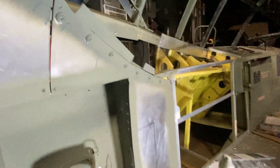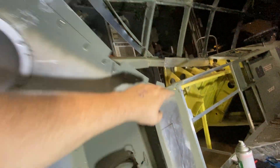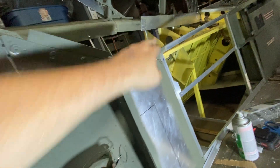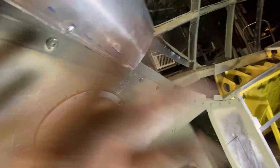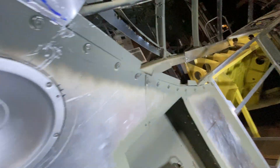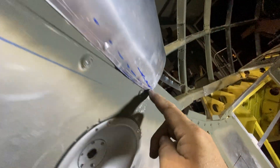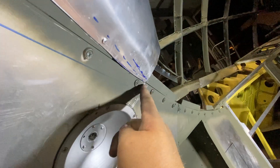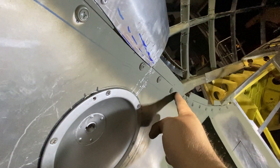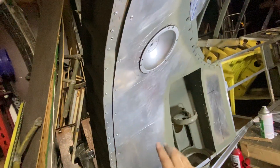First thing I did was last night I studied this line and determined it was a little bit too high, so I came out and raised all of this. I made this channel — it's a back-to-back channel that's bent and reinforced in every kink or bend — so I have a place to put these sheet metal screws. These are going to be riveted — permanent — and these are removable, so this whole panel is removable.